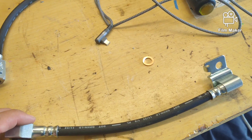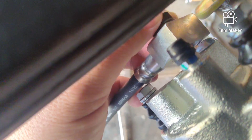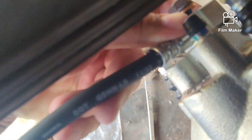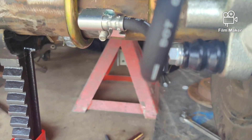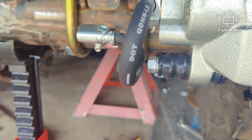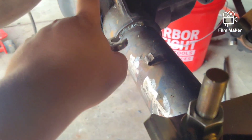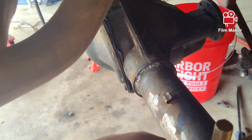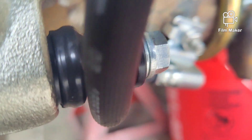We'll take this assembly and start on the passenger side brake caliper. We have our line and our bolt — get them situated in here and hand tight for now. It only sits one way, so we'll tighten that down and connect it to the axle. Brake line is in and mounted to the axle. We'll go ahead and put the driver's side on and get it mocked up the same way. You can see we're going to end up routing the hard lines from here up and over the axle to the center brake line. Driver's side is in.